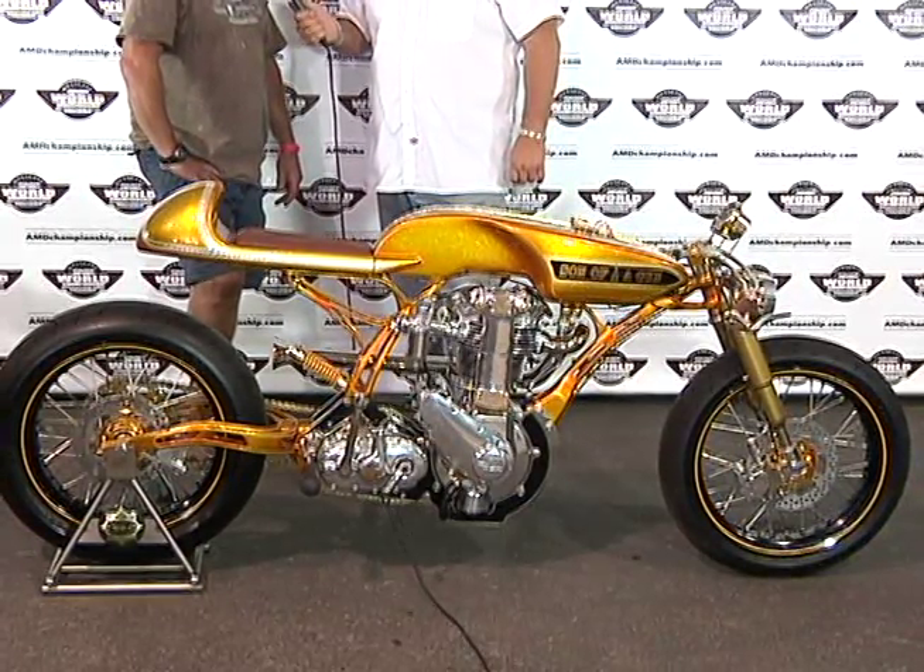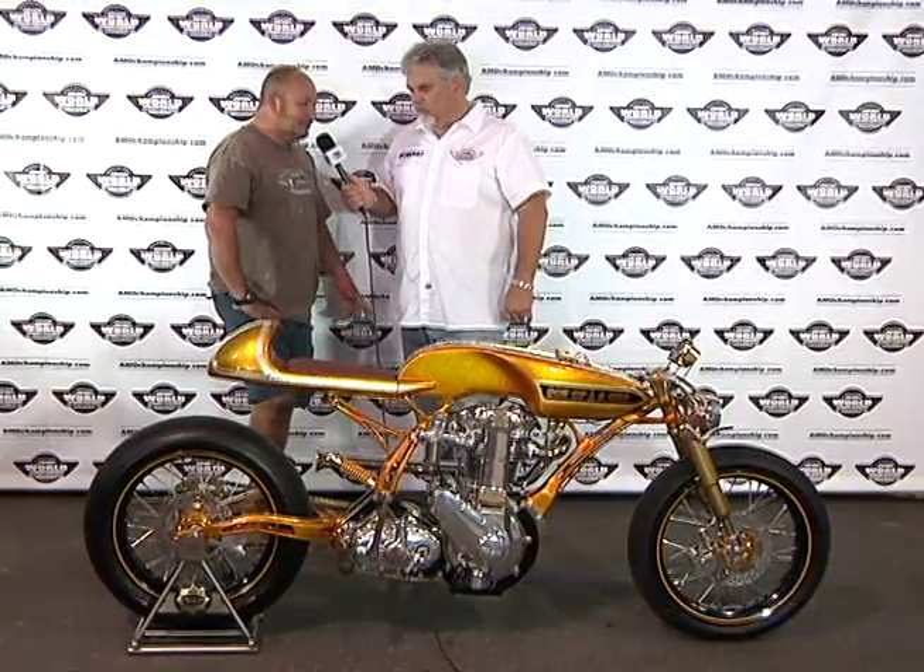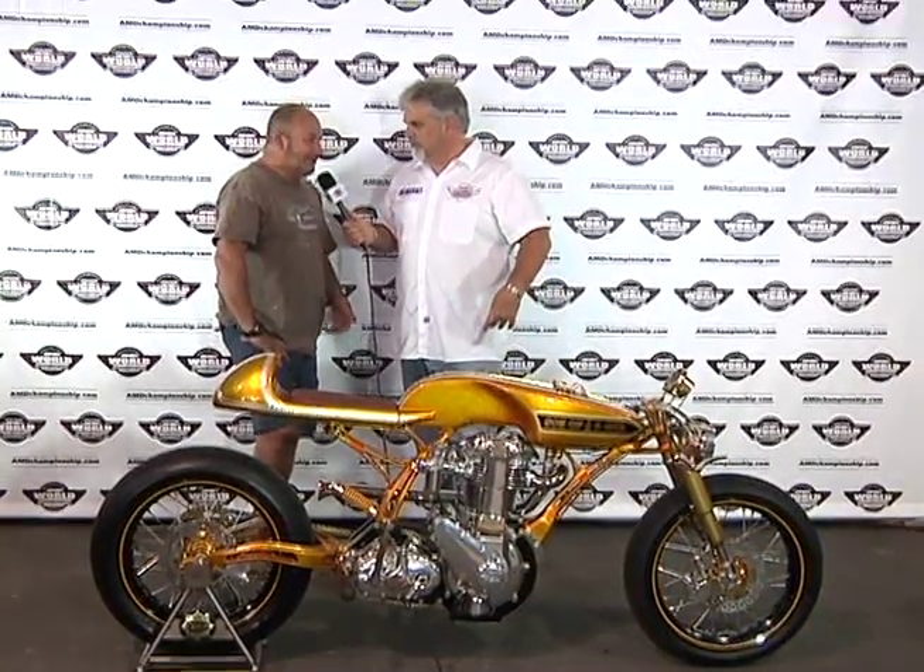The main thing I was trying to do was get away from my machining capabilities. This is my fifth show bike, and people get to know what you do, so you need to try to get away from that. On the headstock, it's all hand-forged — opened up, forged, welded. I think also if it's a 50s engine, you need to maybe use 50s technology in a way when you build something, but maybe also bring in hydraulics and that sort of thing. Otherwise you'd end up with a replica of a 50s bike.